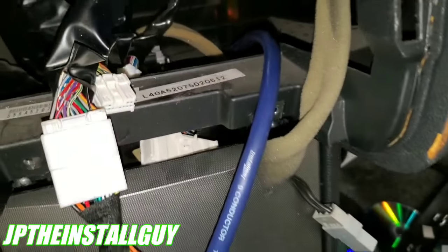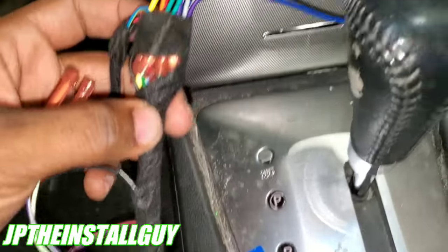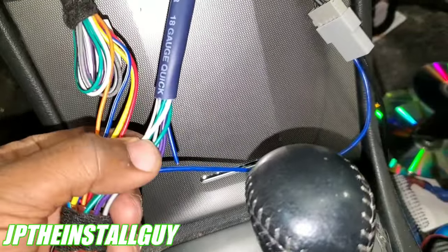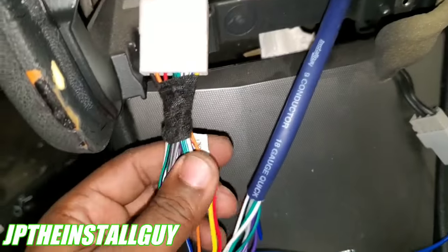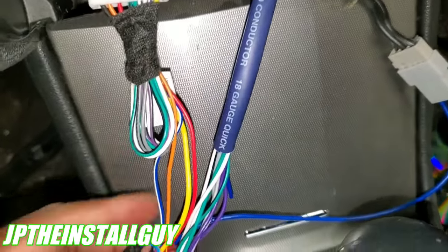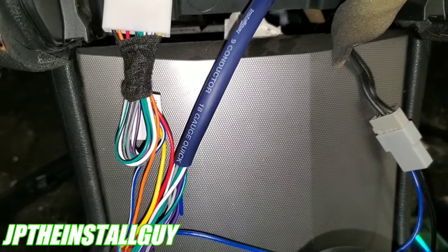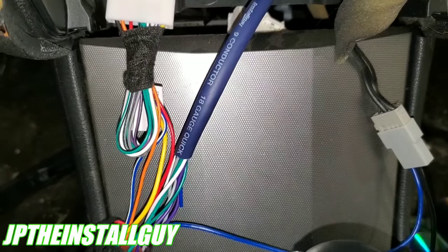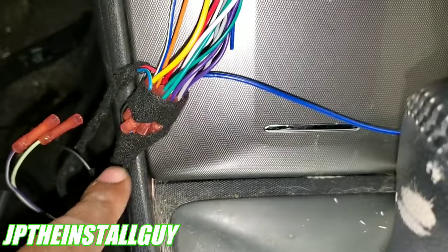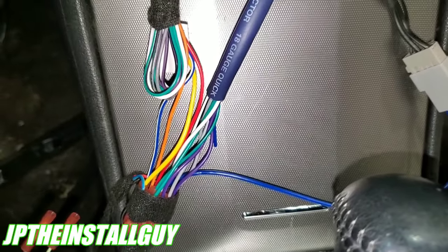As you can see, I've got the nine-wire right along there — it goes between the back, comes right up here to the front, and I've got it wired up directly to my CD player. Now the CD player is going to be outputting power to the speaker wires. I'm showing you that we're not using any of the original harness wires to send signal to that amp because we unplugged it. Once it's all taped up, that's literally it. If you're doing a four-channel amp, you do the exact same thing — instead of going to the radio, you take these wires and go to your four-channel amplifier. Same principle.